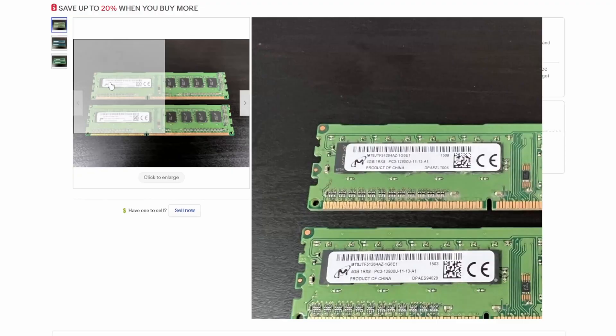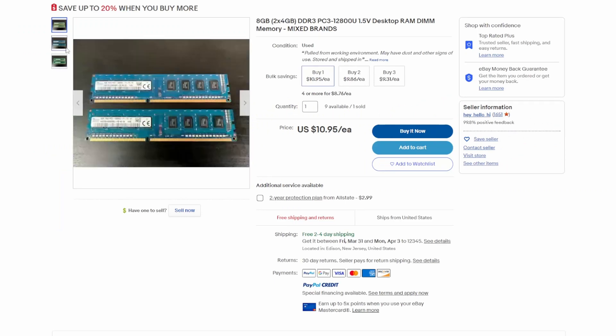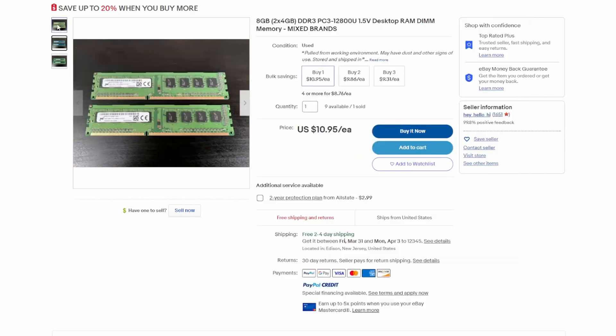It would probably be best to match up the specs of the RAM if you possibly can. So I'm going to do a search on this type of memory and see what we come up with. It's Micron memory — I think that should still be fine if we mix Micron and SK Hynix PC3-12800 memory. It looks like they're just selling a bunch of different ones — this is actually the same exact brand, so this should work. While we're on eBay, one last thing I want to buy is the 8-pin to 24-pin adapter, which is usually a good spot to find this type of part.